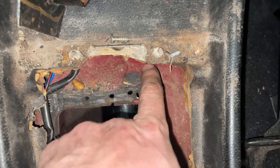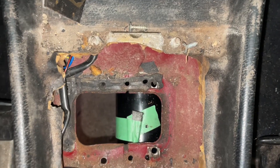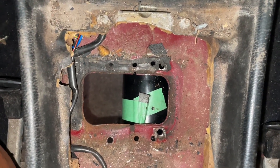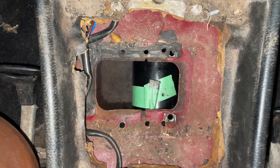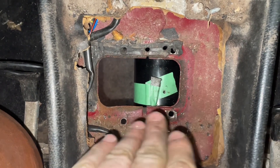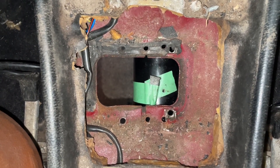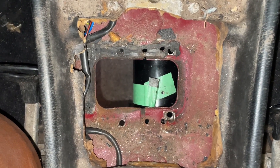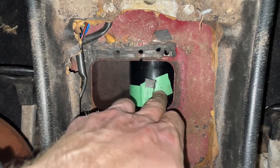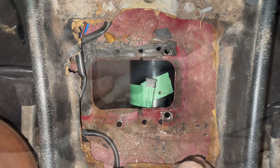There's some minimum clearance right there — I'm going to make two straight cuts and lift up that entire section of the body to set the height for the shifter. The shifter linkage fell to the side so I can't show where it sits, and I'm not sure the length is perfect. I'll probably have to build a small steel box to get room for the linkage and elevate it slightly. But I don't want to damage the driveshaft, so that means getting the car back up and pulling the driveshaft.